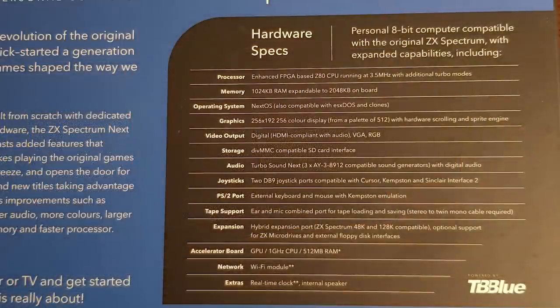Let's check out the specs. It has a Z80 processor with various turbo modes, if you opted for the accelerated version. It has hardware sprites, comes with 1024K of RAM which can be expanded, and a 256 colour mode from a palette of 512. It has a built-in DivMMC for holding files on the SD card and includes three AY chips for excellent sound possibilities. If you opted for the accelerated version you can ramp up the processor speed, with settings from 3.5MHz — the Speccy default — through 7, 14 or 28MHz. These faster speeds can be best used for games that struggled on the original Z80, for example Hard Driving or Driller.